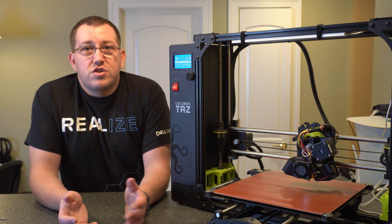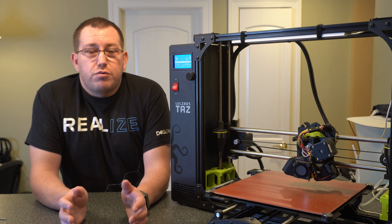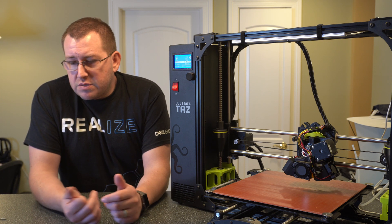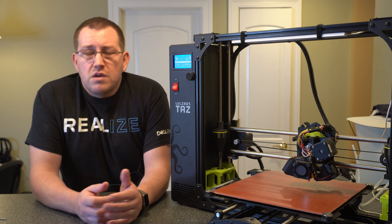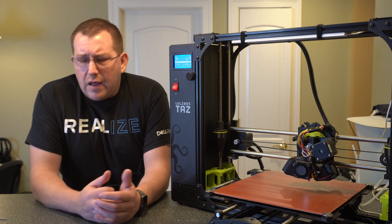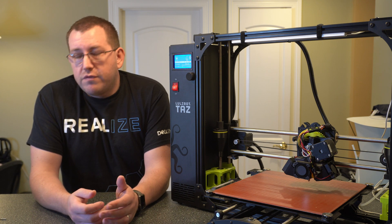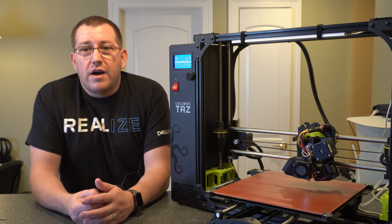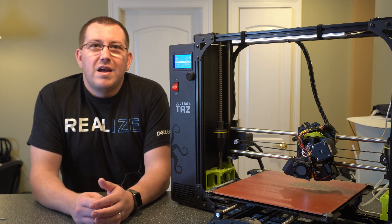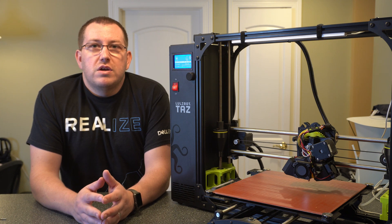Overall, the process isn't hard — it's just taking a couple things off, moving a couple screws, and swapping them out. If you're not sure that the actual probe is bad, you can use a multimeter and check for resistance. You'll have to check what it's supposed to be for that particular probe — I think this one expects around 500 ohms resistance — and I'll link to that process in the description below. I did have to buy this part, I think it was about $18. Knowing this was a refurbished unit and it was throwing the MinTemp error I couldn't get past, I just went ahead and spent the 18 bucks. If you have any questions or would like more information, go ahead and leave a comment below. And if you haven't already, make sure you hit that like button and subscribe — thank you.